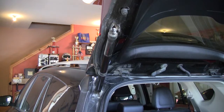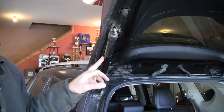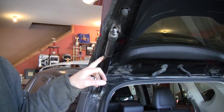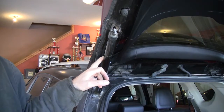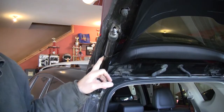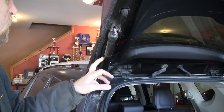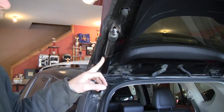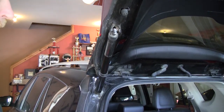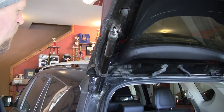As you can see, these struts are misbehaving. So what we're going to do is just change these out. You could change them for the same thing, but they're like $600 a piece used, or reproduction cost from the dealership. So we're just going to put regular compression struts on here and get rid of the auto liftgate. You can do it for less than $100, and I think it's going to be a much better deal.